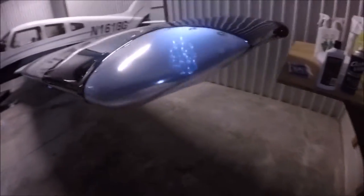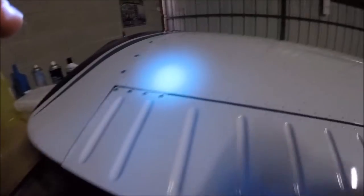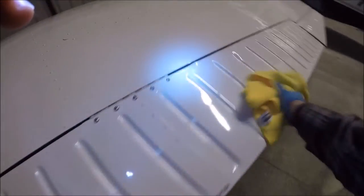What I'm checking here a little more in depth: making sure there's no cracks, nothing's loose, there's no bugs, there's not an adjacent squirrel. Going through, actually literally crawling under the plane to see that there's nothing wrong. It gives me a chance to look at the tire again, see if there's any dents, anything crazy going on with the flaps or the ailerons. Wiping along, going down the aileron, making sure the functionality is correct and it moves freely. Flaps are locked, good to go. Cleaning as you go — if you did a normal check without the cleaning portion, sometimes you would miss issues with rivets, pops, or so on and so forth.